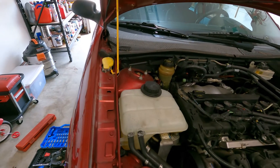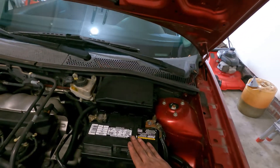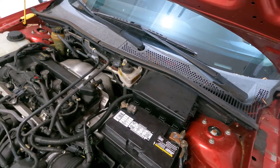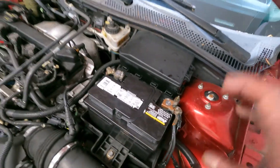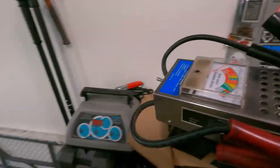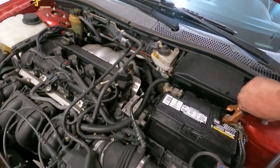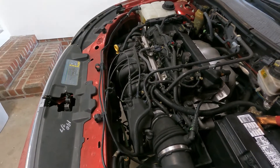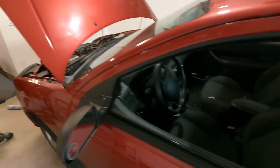I buttoned everything up: coolant reservoir, all that good stuff, tightened the bolt, battery cables. This is actually the best time to clean your battery cables since you had to take them out anyway — use an emery cloth, make sure there's no corrosion, and check the connectors for stress cracks because sometimes they won't clamp properly. That's the best time to do it. Now let's go ahead and put in our battery tester — I want to make sure this thing is charging, because just because the car starts and you don't have a battery light doesn't mean it's working. We're just about 13 volts — let's start it up. Helps if I find the key.